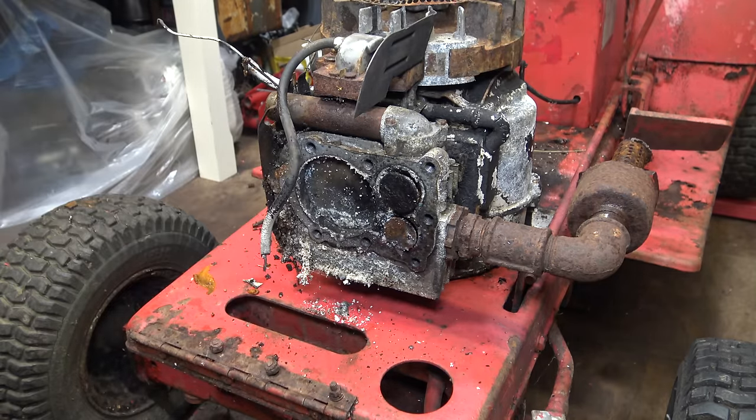The exhaust valve wants to be between 9 and 11 thou. So we'll fully shut the exhaust and fully open the intake. And I think we'll start with 10. Seems good. It usually is best just to start in the middle and work from there. The intake valve, which was stuck, is now moving very freely in and out. So that is the valve work completed.